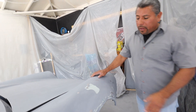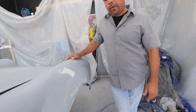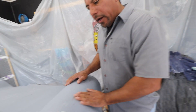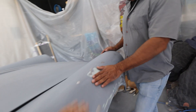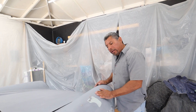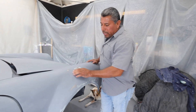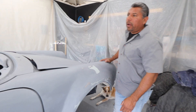The question I had was: there are no flat spots on this car because it's a 911, so it's easy to freak out seeing something like this — I don't think that's a high spot, I think I just sanded too much. Right here, those are definitely spots that should be addressed. It's not a glazing situation — you need to tap it down with a dolly and hammer, get it to the same level as everything else, then put a little glaze on it and block that in. That low spot is just a little glaze — not a big deal.